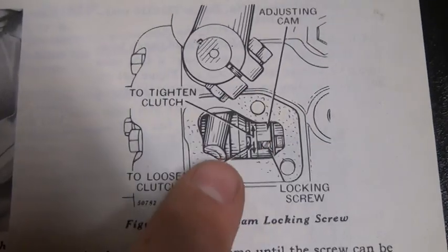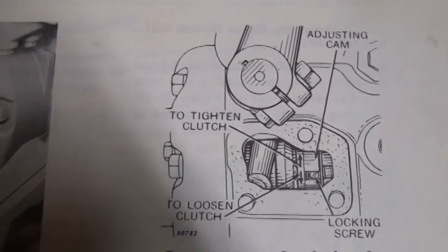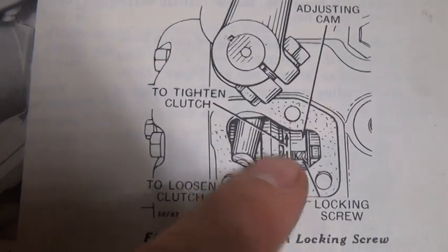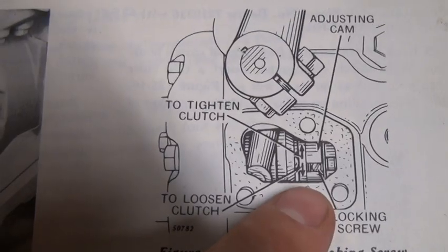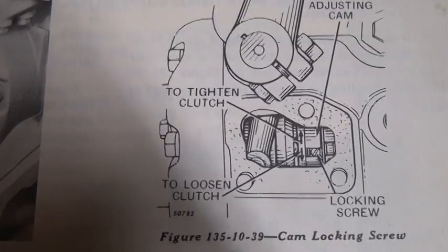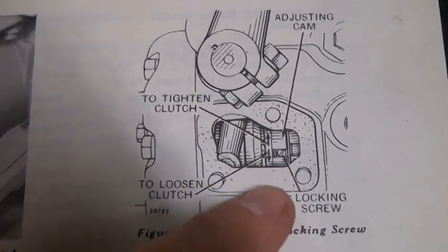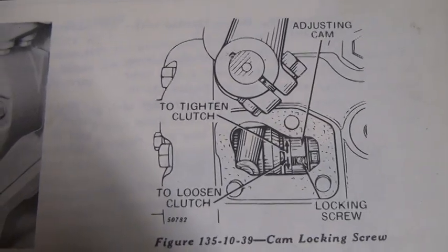You can pretty well go all the way in using a screwdriver, and to tighten the clutch we would spin this cam upward. You would have the pedal in the neutral position and make sure the transmission drive portion of the drive line is engaged so it's going to hold everything stationary so that cam can spin. You take it one of the four slots at a time using a screwdriver or a small pry bar, and each slot accounts for about 15 thousandths of an inch. So if you needed 30 thousandths you could do two slots, or 60 thousandths you could do a complete four-slot revolution, taking it 15 thousandths at a time and then rechecking the clutch adjustment.